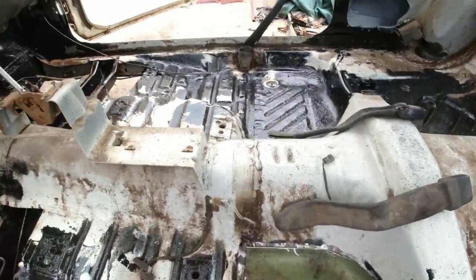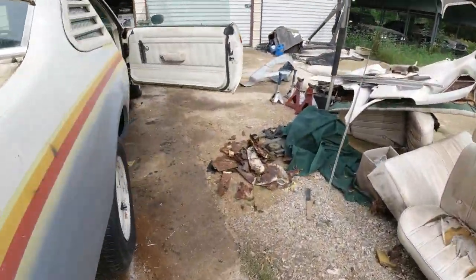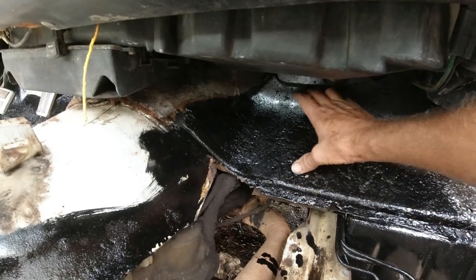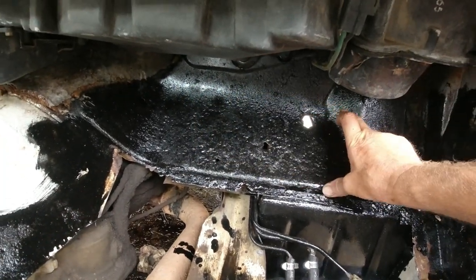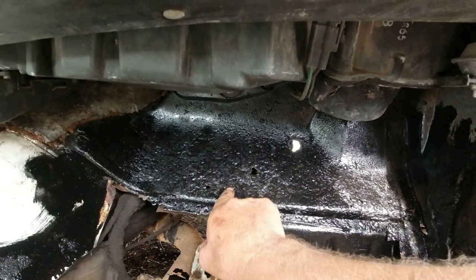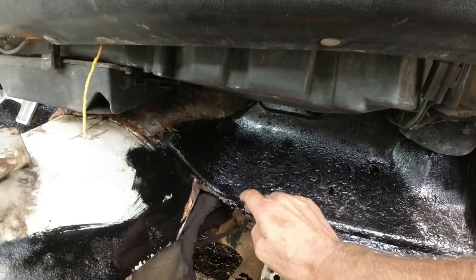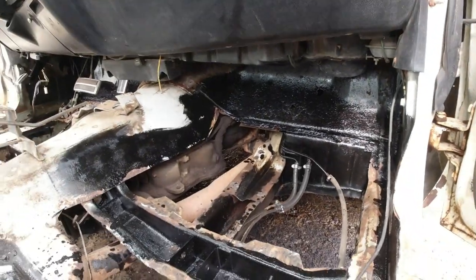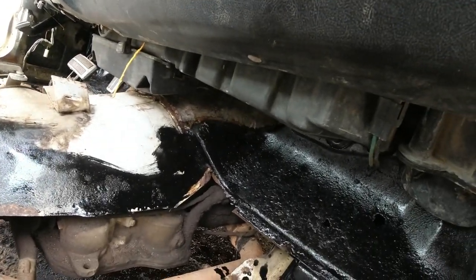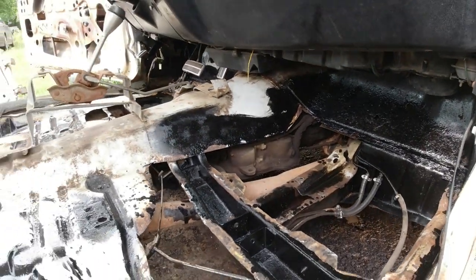I got that piece done — fixing to do the passenger side. On the passenger side it's going to be a little bit tricky. I'm probably just going to put a piece of metal over top of that area, then weld that piece of metal into this brace here and make a lip on it. Cut out the other floor pan so it can weld to a lip like it's supposed to, and then come across — after that it should be a piece of cake. Drilling these spot welds out is going to be tough, but I'll figure it out.